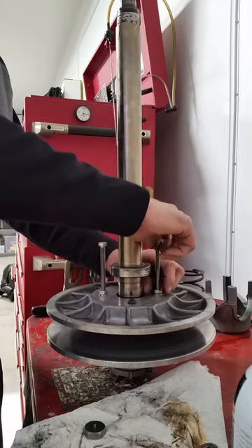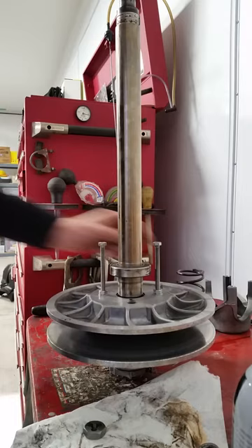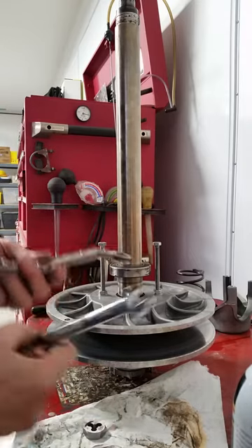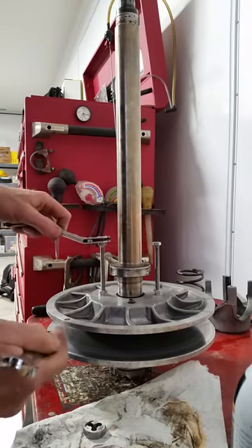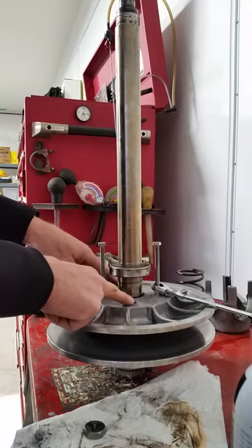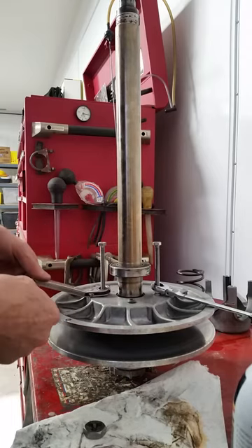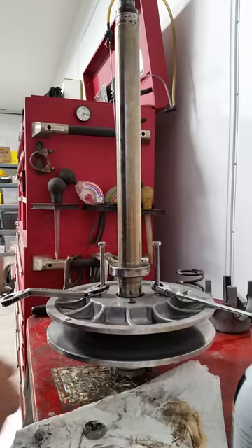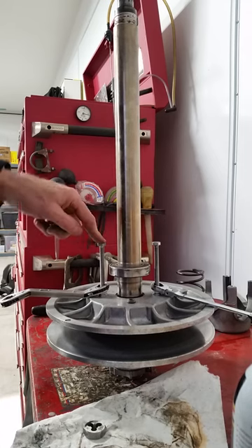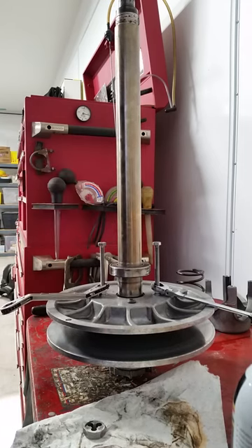Use a vise — it's a lot safer — and a couple of ratchet wrenches will make it go a lot faster. Remove your last two bolts; these will contain the clutch. Back the nuts off and the clutch will come apart. Just make sure your bolt does not back out as you're loosening. Total investment: two dollars and fifty-three cents.